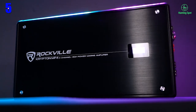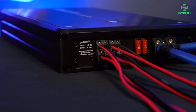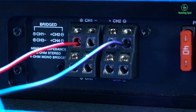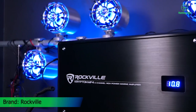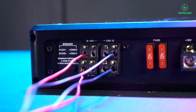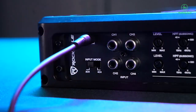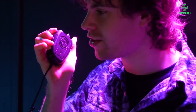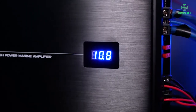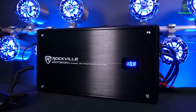We took the sound of our Krypton car amps and added top-of-the-line marine-grade parts so that they will last forever and withstand even the harshest conditions on the water. We went a little overboard — no pun intended — to make this amp marine-ready. We conformal-coated the PCB board with a waterproof glue that is painted on to protect the circuitry. The heat sink, including the bottom plate, is made of aluminum which is rust-proof. The end panels, internal mounting screws and hardware are made of stainless steel and are rust-proof.